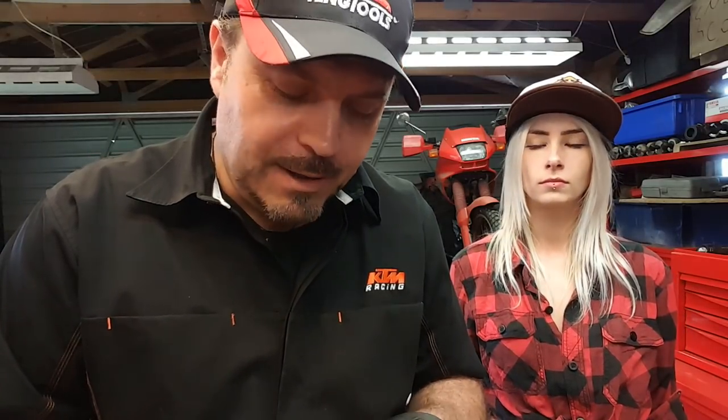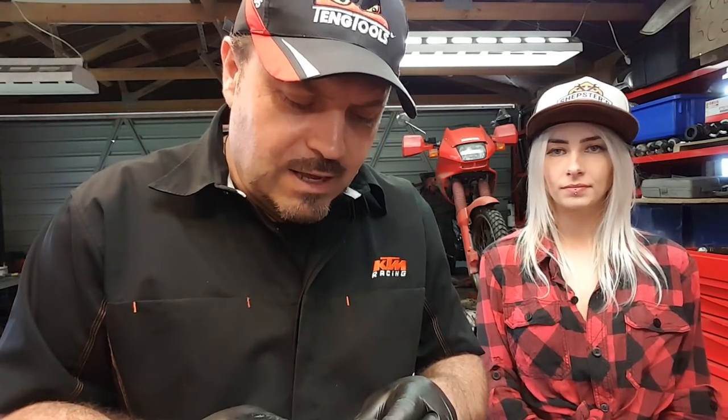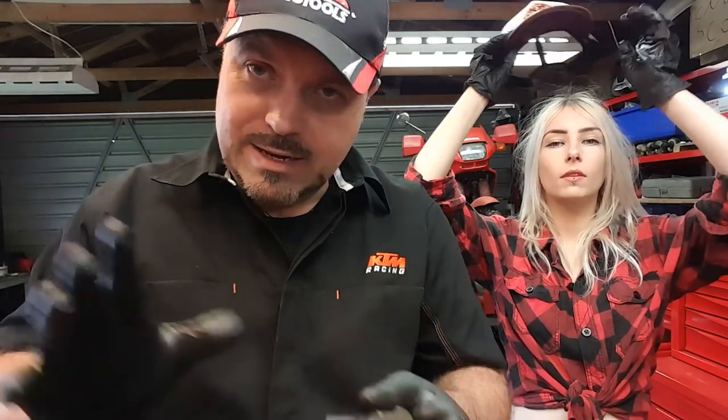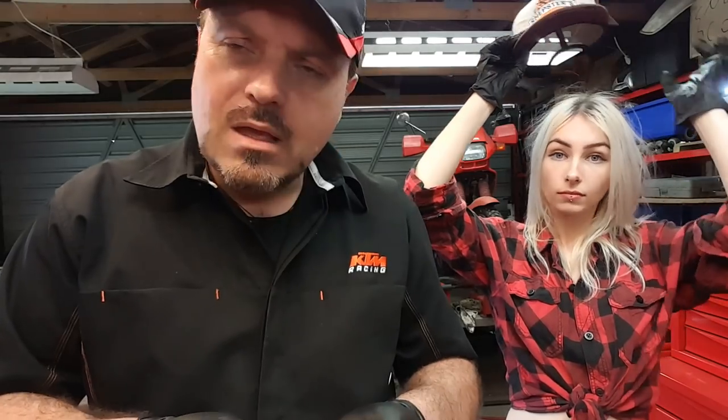Universal joint on the steering column. A friend of mine who's been working on a really old American car, the customer complaint was that the steering was tight. And then when they turned the steering wheel, it then suddenly went a bit slack, and then it got tight again, then it went slack, and then it got tight, and then slack. Old school cars. Yeah, pretty much. And the garage that they took it to fix it, replaced the steering box. Now, it's old school. It didn't have a steering rack, it had a steering box. And it was still the same.